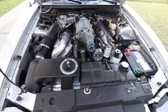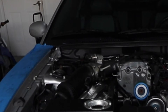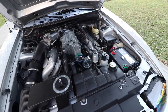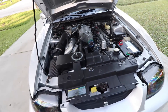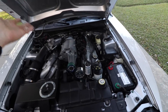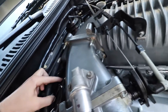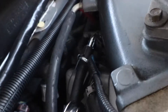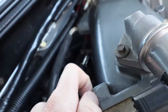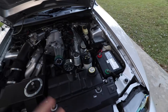As you saw in the beginning of the video, the reason why — my fuel line, by the way — that was my fuel line that came undone and I started spilling fuel all over my engine bay. Thankfully the engine was cold, but if it had been hot it could have really caught fire and that would have been it. Learn from my mistakes: always pay attention to the small details because of things like this. I fell victim to that safety clip — when the fuel line pressurized, this thing came undone and started spilling fuel all over the engine bay.